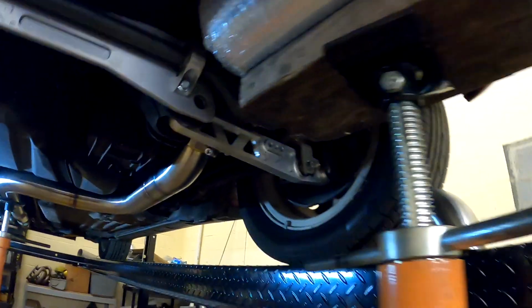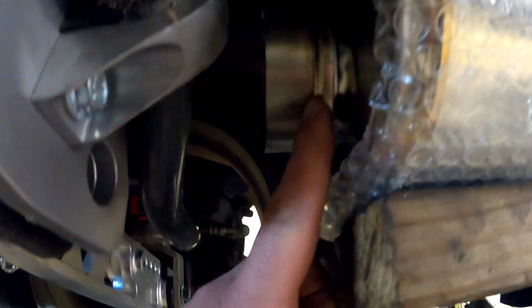But you can see why I said things are gonna get a little tougher, and then the sway bar is literally right in the way. So we gotta go up, over, down, angled, and then back over all in this short period of time. So I'm probably gonna actually have to cut the mufflers back on both sides. And there's not really an easy way to do that.